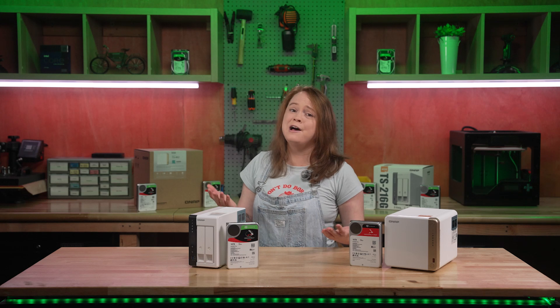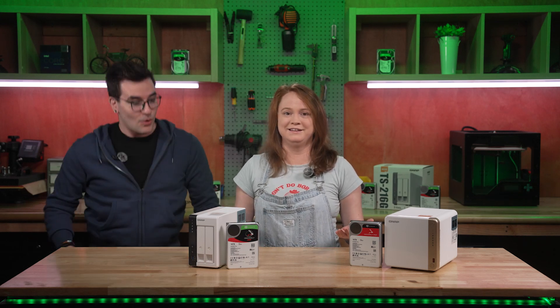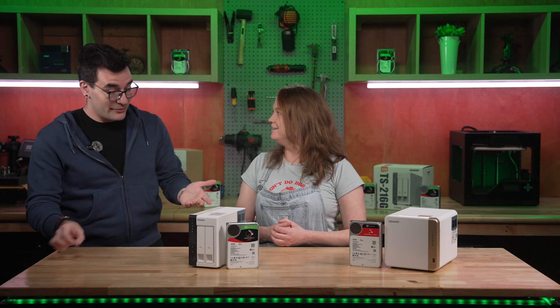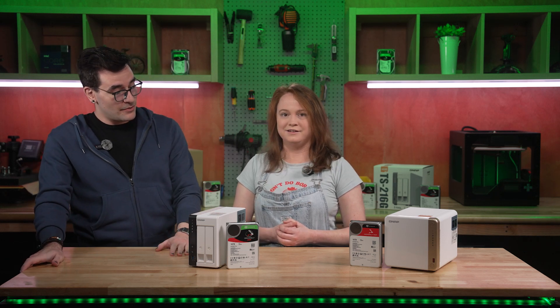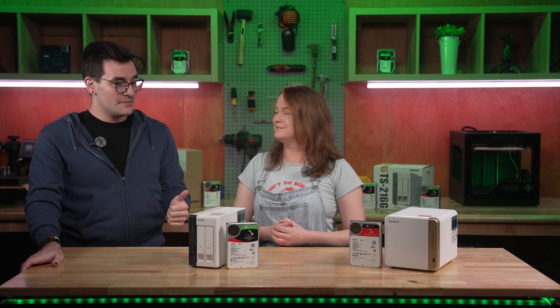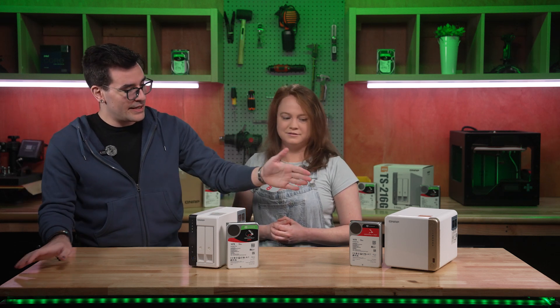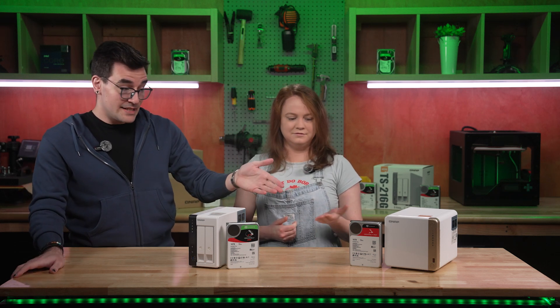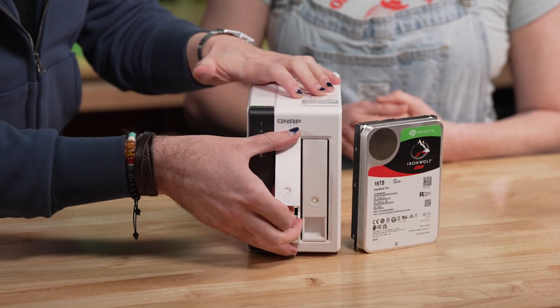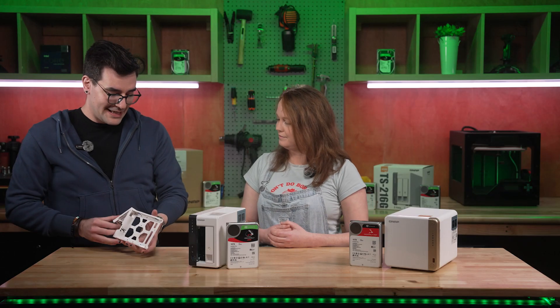You may be asking yourself, how does one build a NAS? Are you building a NAS? It's James! It's thankfully pretty simple and straightforward to do — I can show you if you've got a minute. I would love that. So all you need is your NAS and then a bare drive like the Seagate IronWolf or IronWolf Pro that we've got right here. It's a pretty simple one-step installation — pull out the hard drive caddy.